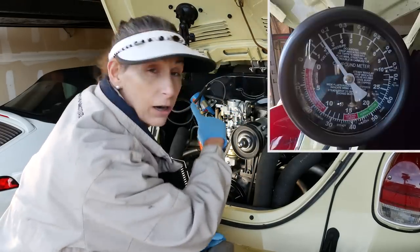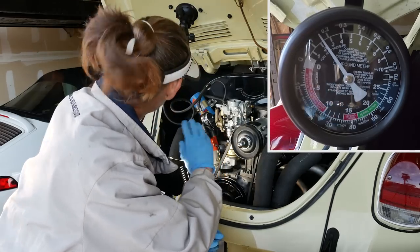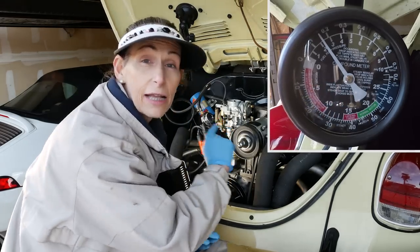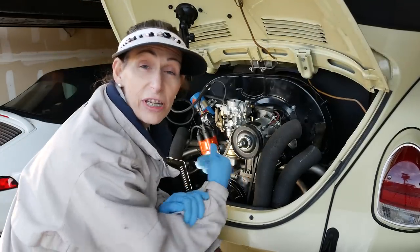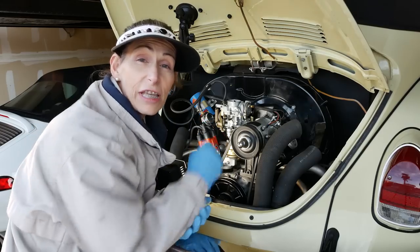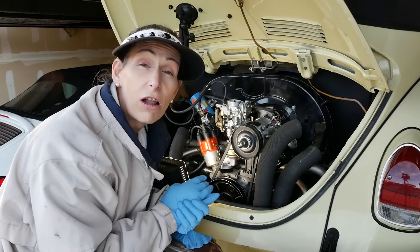I don't smell anything right now. And if you look, our pressure is still holding true at 2.5 PSI. So that's really great. That also means that it hasn't blown past the needle and seat. So at this point, we just have to figure out a way to sort of mount this thing and reinstall our fuel filter as well.